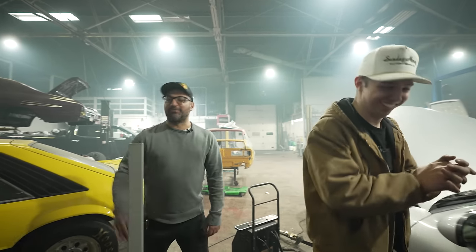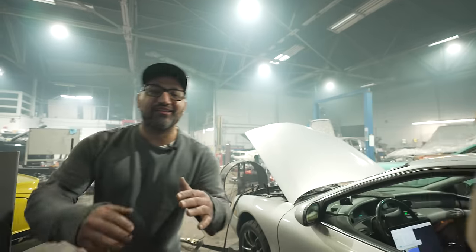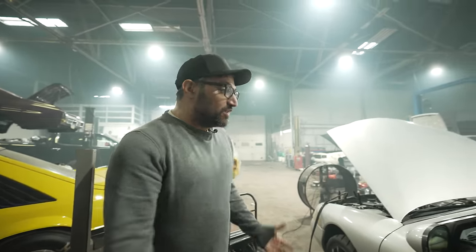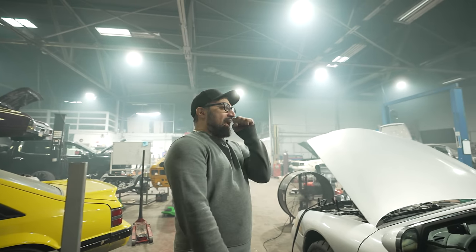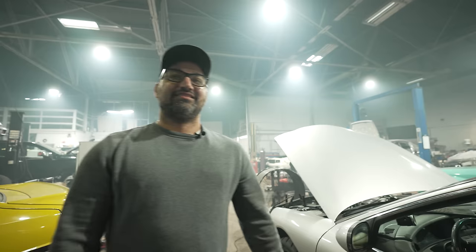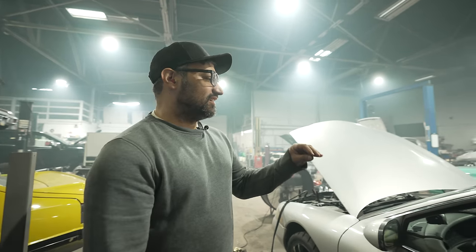Hey, come on, dude. We're calling it 500. 500 wheel horsepower. You know what that means? It wants more timing. It loved the timing. You give it another degree, you hear it, and it took off. One degree. Dude, it sounds nuts.